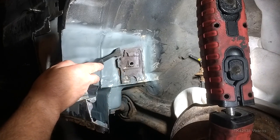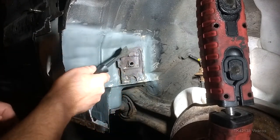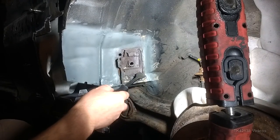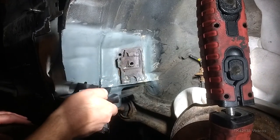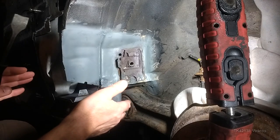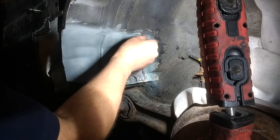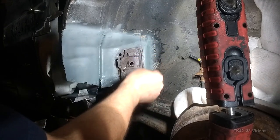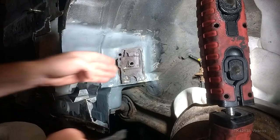This part here is obviously the inner wheel well and all this is attached to the wheel well with spot welds from the inside of the car - I think two spot welds, and probably another one there as well. Considering this car is 31 years old, Rover's underbody corrosion protection has done a really good job. It's kept a lot of the rust localized. This flexible PVC rubberized coating under the stone chip is incredibly tough, but obviously the seat belt mount is one area you do not want to get wrong, so that's what I'm doing.